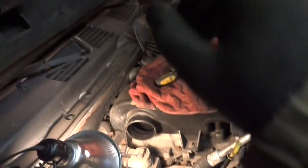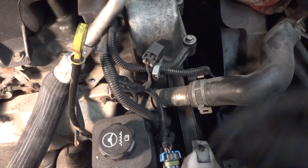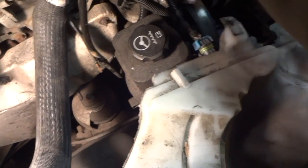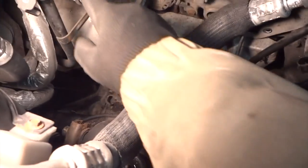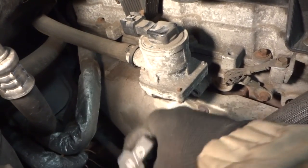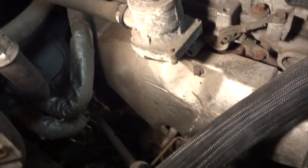We got the air cleaner out of the way. Before I got the air cleaner off, I had a problem right here — these things rust like crazy. Couldn't get that off, so I took my Dremel tool and had to go in here and cut that in half. I've got these two bolts out — one here for the air conditioning line, one over there. This will let me flex it. I've got a couple connectors here on the hook — I just kind of put this off to the side. Now the next thing I'm going to do is go ahead and get this piece here off. I've got the 10mm and the 13mm nut out. Pull the dipstick out, wiggle it a little bit, and just kind of move it out of the way.